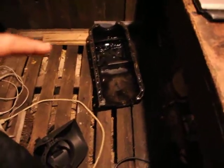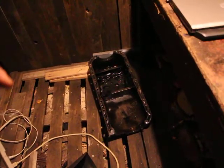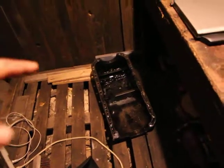But modern cars have aluminum pans or antimony pans. Pardon me. And those things will crack. Right, steel here, sheet steel, it won't crack. It'll only warp. And actually, I didn't know about that, and I guess I was in a hurry, and I've seen that the oil pan there has a slight warp to it already. That's no big deal, except that depending on where the warp is, the oil will actually puddle in there, right? And so you have what we have there.